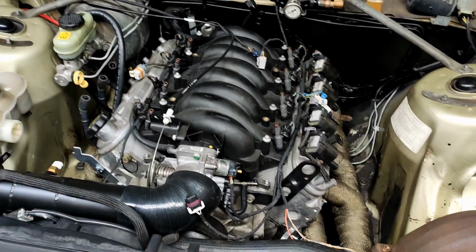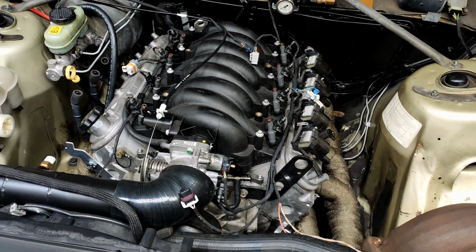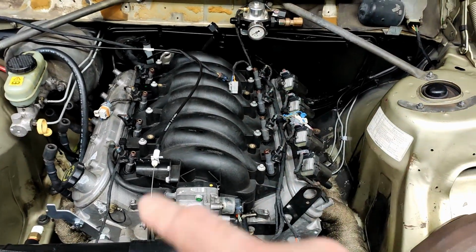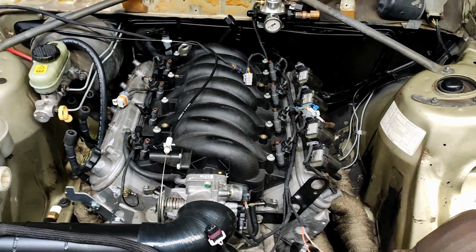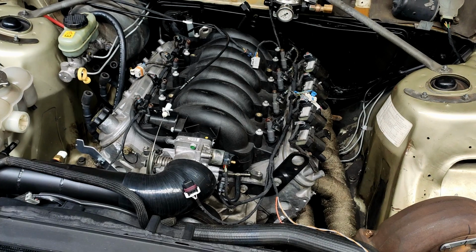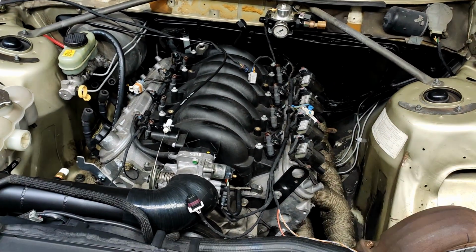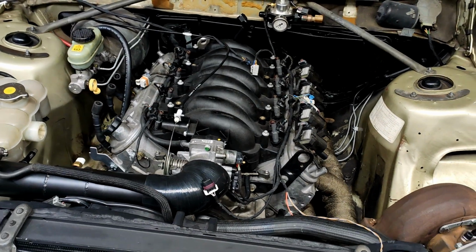I've just pulled my injectors out. I had a set of, I think they were 80-pound Siemens injectors, and I've just put the stock set of LS1 injectors back in. My friend Andy, who's going to help me with the tune, wants to just do a baseline calibration with a stock 1-bar map sensor and a stock set of injectors, so he's got known referenceable data to tune in the VE.